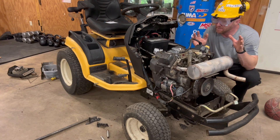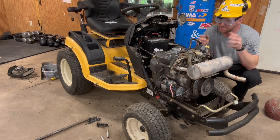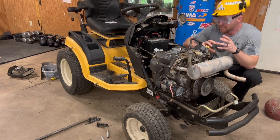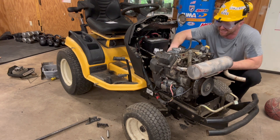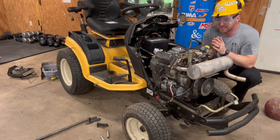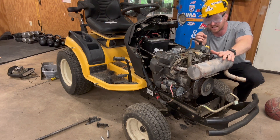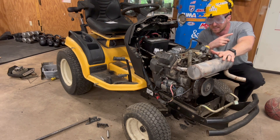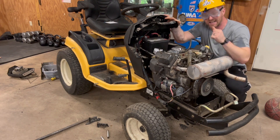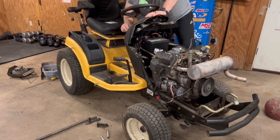We're back for round two. I'm going to try to start this engine again. I've got my full Cub Cadet safety gear on for engine starts, because you never know — this whole thing could blow up. What happened last time is the driveshaft coupling actually blew up live on air, causing that driveshaft to ram into every piece of plastic on the back end, shattering things. I've pulled out all the plastic. What I'm going to show you is how this thing starts and what happens when your crankcase gets pressurized — pressure coming from the cylinders either past the piston rings or through a head gasket, which I think is the problem. You're going to see pressure come out of the oil dipstick tube, which is a classic engine problem sign.